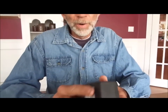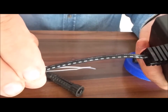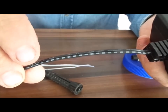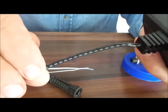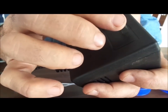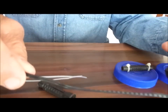What we've done on these converters — you want to keep your polarity right. If you'll notice on your converter, on most all your converters, you will find one side of your wire has a tracer on it. That's those little white dots that you see there. When you see that on a wire, it'll either be a tracer or the side of the wire will have a rough feel to it — little grooves cut in it. That usually is the common side. On some of your converters, the plug-in up at the top will have a wide side and a narrow side so that when you plug it into the wall, the wide side is always your common side and the narrow side is always your hot side. In order to keep the polarity right, you want to make sure that you run this all the way to the end down here.